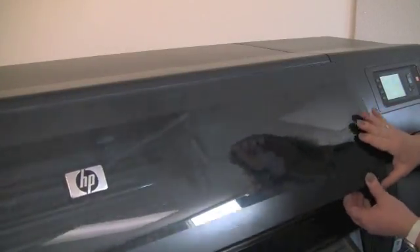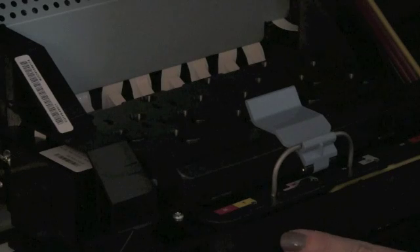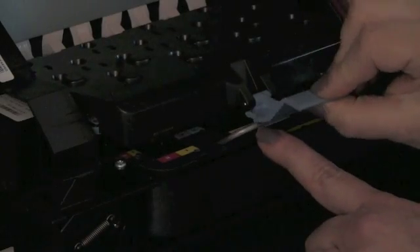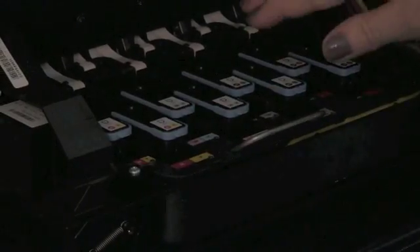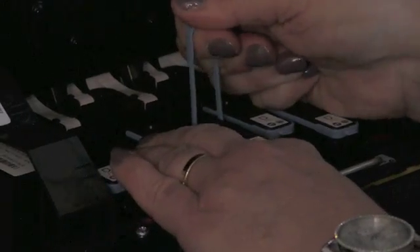You can tell when the print head carriage is moved to the platen. We'll lift it up and have a look. In addition to the print heads being in this area, this is also where the cutter and the internal spectrophotometer are housed. You can also see the ink lines that are full of ink continuously replenishing the print heads. To begin the procedure, take the blue lever and move it forward to disengage the galvanized colored loop. Any of the print heads can be replaced by simply lifting up the blue handle on the print head and lifting it straight out.